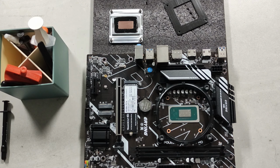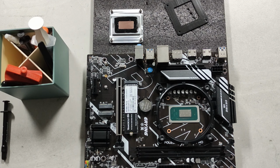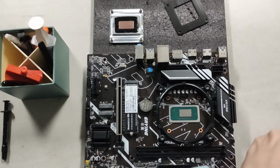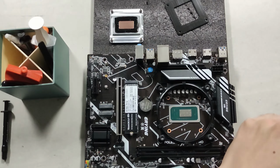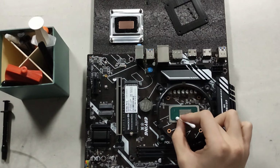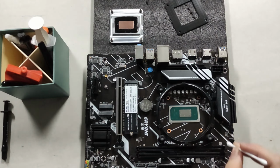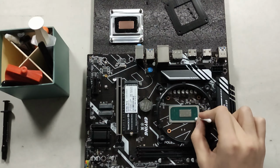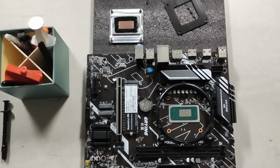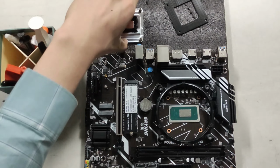That's alright. Yeah. The critical thing to have here is maybe have a small bag to store all your used cotton buds so you can dispose of them cleanly. You don't want liquid metal to stain your desk. You don't want it to stain anything, not your clothes, not the CPU, not your work desk, not any aluminium heat sinks especially. So there you go, we've got all this cleaned up, got all the edges cleaned up, there's no thermal paste on this whatsoever. You just use a bit of limonene first and then a bit of, you know, alcohol.